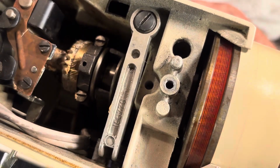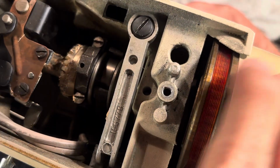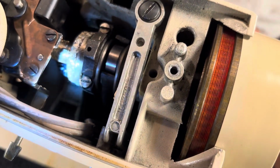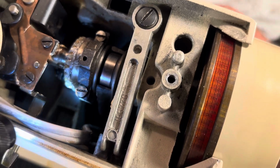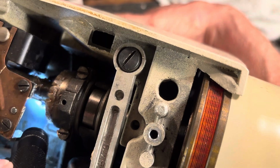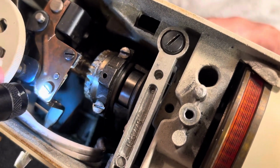I'm just going to do this because it's taking forever. I'm just going to bypass the daggone camera for a minute because we got to tighten this thing down, because, you know, there's only so many hours in a day. And of course the set screw will be on the completely other side. There it is. So when I rolled that around, I made sure that the gear rotated, but I kept the shaft in the right spot so it wouldn't be off the notch.